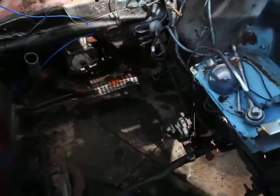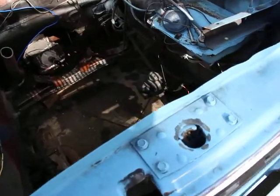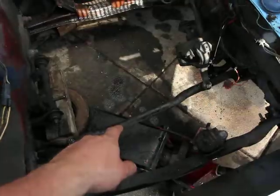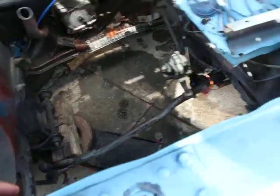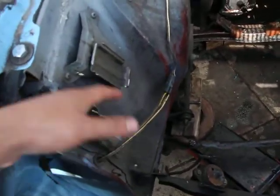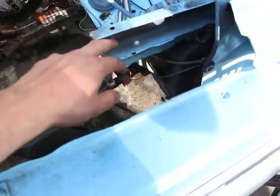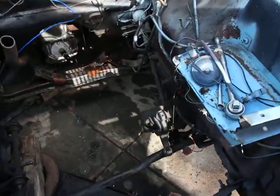But it would have been more difficult — I would have had to put the engine on a little dolly and pull it out through the front, lift the car up. And I think this cross member here, the steering linkage would be in the way. I just don't like this being welded here directly. The engine comes out through the top really easily if this thing is not in the way. And I didn't like that it's not a pipe — I really want it to be a pipe. So that's my reason there.